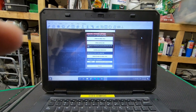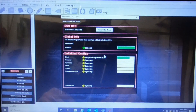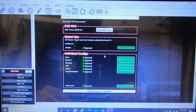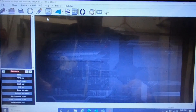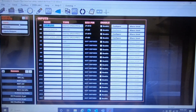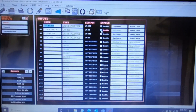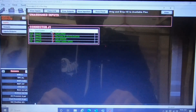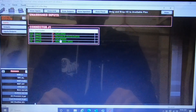So gonna make sure the car is on, plug that guy into the harness, and then I'm gonna download from the ECM. It's just pulling everything off the ECM. I'm gonna go from the beginning on how to set this up — you want to go to Input/Outputs, then Input. So I created this — I called it 'clutch switch' — type is grounding, so when the switch is closed it goes to ground, and then you click the box to enable.